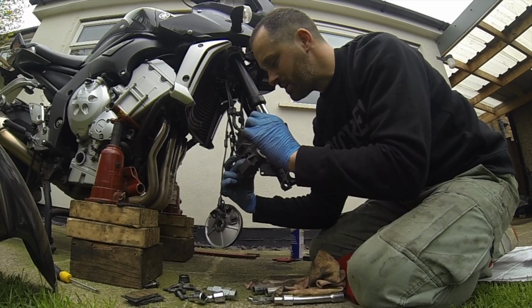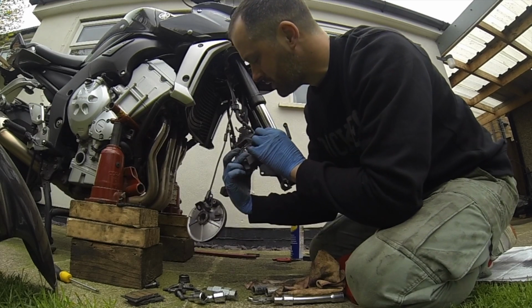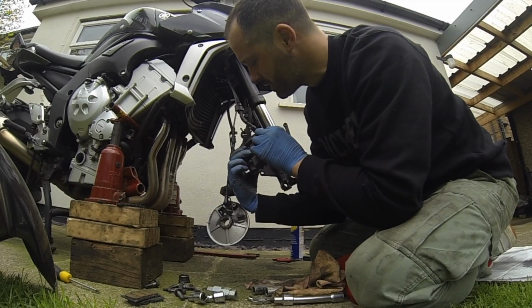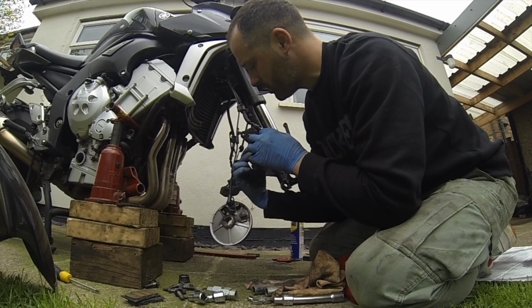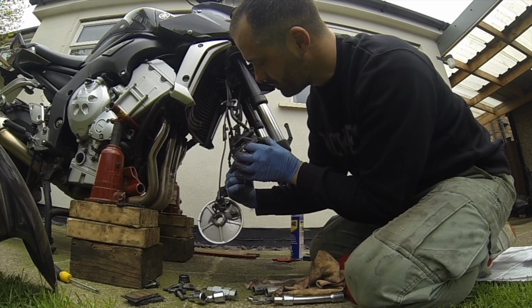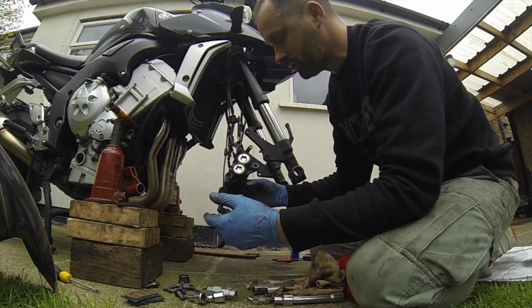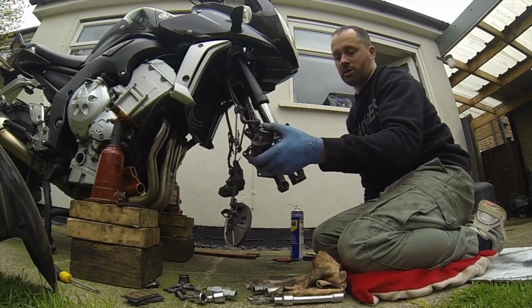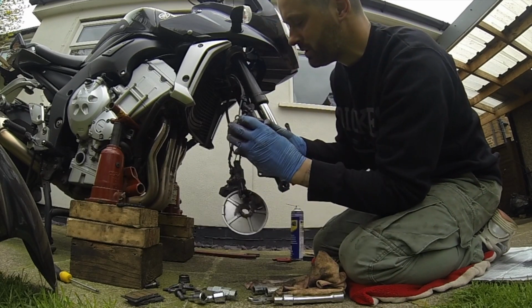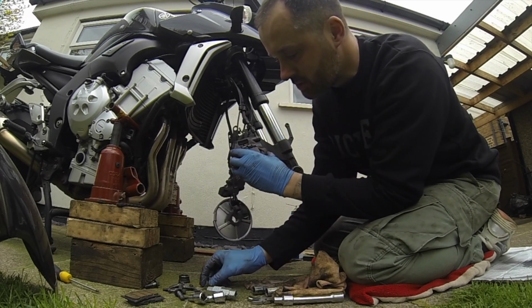pads. Your pin goes through there into this first disc, into the first pad, and then you need to go under the little spring lip there into the second pad and then out the other end, and then they are secure other than your pins. Now you need to put your pins in. If you're lucky, your pinholes will be facing outwards, which mine are on this one.